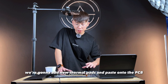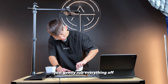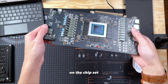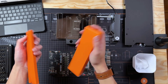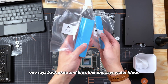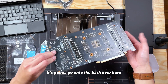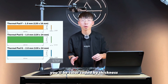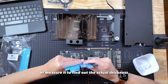We're going to add new thermal pads and paste onto the PCB, so we're going to clean this up first. I have my rubbing alcohol wipes here — just gently rub everything off. It's okay if there is a little bit of tiny residue left on the chipset; it won't affect performance. Next, grab your orange boxes — these have thermal pads inside. The block comes with two types of thermal pads: one says 'back plate' and the other says 'water block.' We're going to need the water block one first. Now, EK labels their thermal pad sizes with different colors — if you look at your manual, it will be color coded by thickness, though you'll still kind of have to eyeball it or measure it to find the actual thickness.